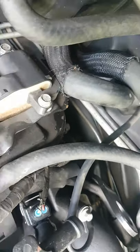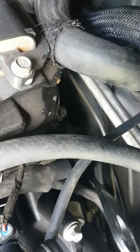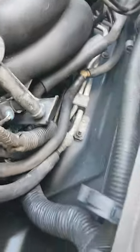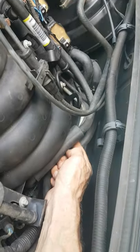That one had to be removed because that's what held the dipstick tube. Undo that bolt, pull the dipstick out the top — boom, that's done. Then you can get to the bolts at the back that you apparently can't get to, except for the one very top one in the middle, right at the back of the motor.